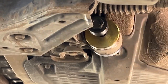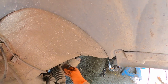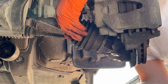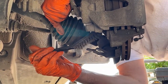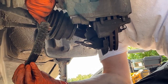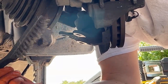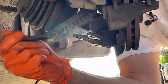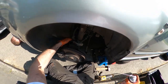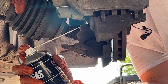Before I get it off the end I'm just going to give it a little tap with a hammer just to free it all up. Now that we've got the new bushing in place and the old arm out, we need to remove the old ball joint. First I'm going to use a wire brush to get as much rust off there as possible to make removal of that nut as easy as possible. I don't really want to have to cut it off with an angle grinder if I can avoid it, so the cleaner the thread is the easier it will be. Then we'll put a bit of penetrating oil on it. Whilst it's tempting to skip this step, your future self will thank you.